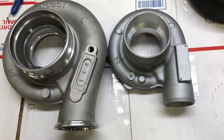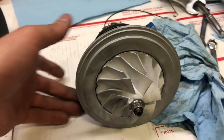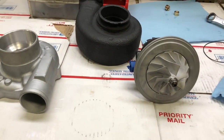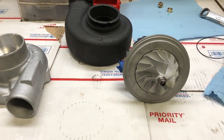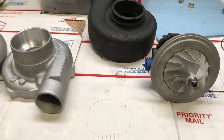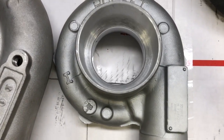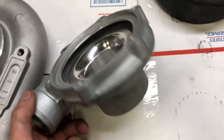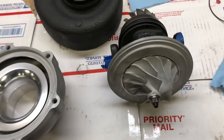The HX35 compressor wheel we used is 54 millimeter. There is a smaller one, but it's really rare — it came off of a marine application and is 50 millimeter. So this is what I had to work with: a 54mm by 78mm HX35 seven-blade compressor wheel. There's also a 56 by 83 eight-blade, but this is the smallest one, so that's what I wanted to go with. The previous wheel was probably less than 50 millimeter — I think it was in the 44 or 45 millimeter range — so it was a pretty big upgrade.